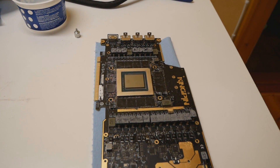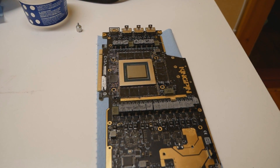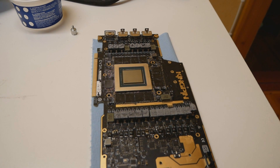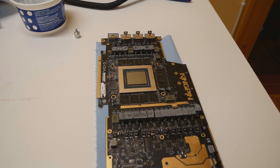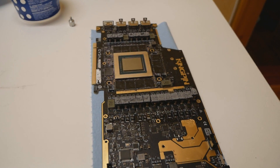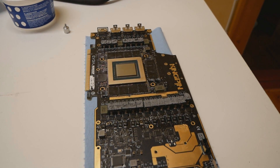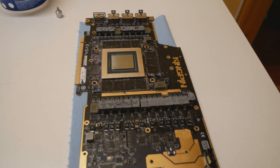Back to the topic about GPU lapping. Some time ago I made a very in-depth video about GPU lapping as I was going for full pot temperatures with the RTX 3090 Kingpin, and I wanted to make the GPU surface as flat as possible to avoid thermal paste cracking, which usually occurs somewhere around minus 160 degrees but depends a lot on the particular graphics card.